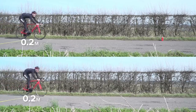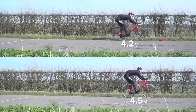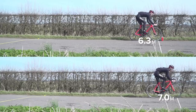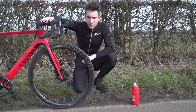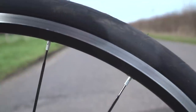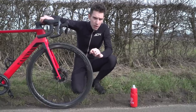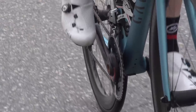The result? Well, almost identical — and that hasn't taken us by surprise. The brakes on the mid-range bike are fantastic, and disc brakes only really come into their own in the wet. And thank goodness today is not wet. There's also a slightly funny thing to mention: a mid-range bike is almost always going to come with aluminium rims, which tend to offer better braking performance than carbon ones. So there could have been a situation where, were our superbike to have had rim brakes, it may actually have performed worse in this test than our mid-range bike.